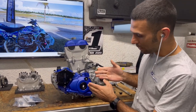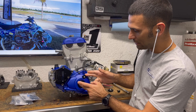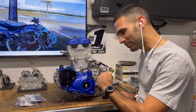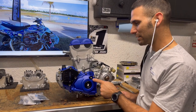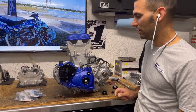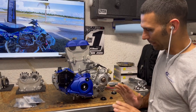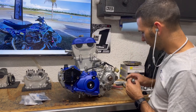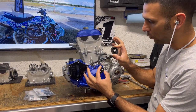On the engine side, this plug is a 17mm socket — and what's behind it for the flywheel is also a 17mm. So if you need to turn the engine by hand, you have the same tool in hand once you take that plug off. Then there's a 10mm, so most people will have a 10mm socket and a 17mm socket — instead of needing a 10mm hex and an 8mm hex allen key — which makes life much simpler. In 2009 to 2013, they did have aluminum plugs, but they were very shallow and would strip easily — that 6mm would just strip, and I've had to chisel them off with a hammer.